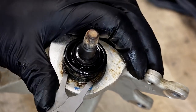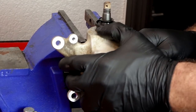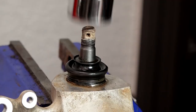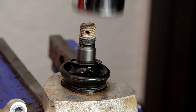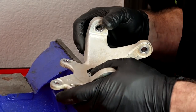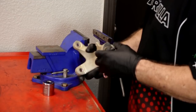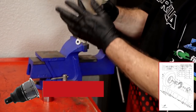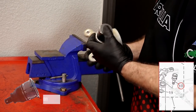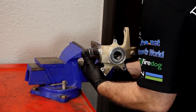Let's get the circlip pulled off. With our circlip off, we're going to pop it up here in the vise and we just want to open it up just enough to get around the back side of that ball joint and see if we can drive it out. She's out — not real pretty, but that's a way to get it done. The surfaces look good here guys, everything's clean enough to go back together. We can't use the press because of just the way this thing is designed and we don't have the special tool — so I'm using a socket big enough to go around the front side and we're going to use our vise to drive it back in.